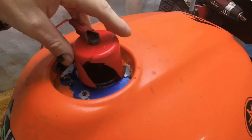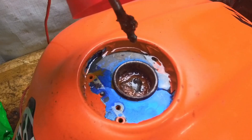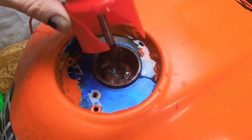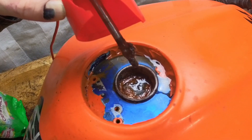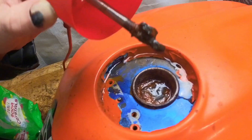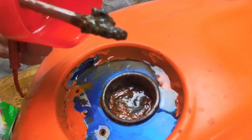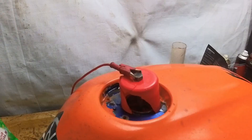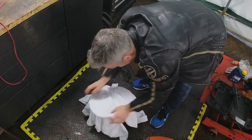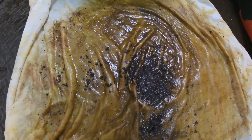It's been on for three days now with the battery charger on. This is genuinely the first time I've taken this off in three days — oh look at that! It's like a turd, that's awesome. The aerosol cap cracked when the tank fell off the bench, but look at the build-up on that — that is the rust from the inside of the tank, now attracted to this bolt. Some of the bolt has also disappeared. Time to change the water and get it back on for another couple of days.